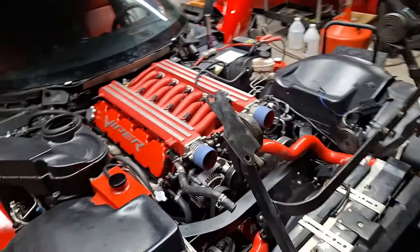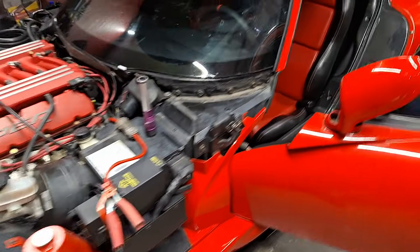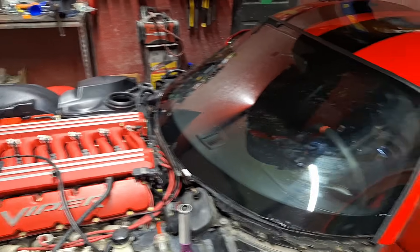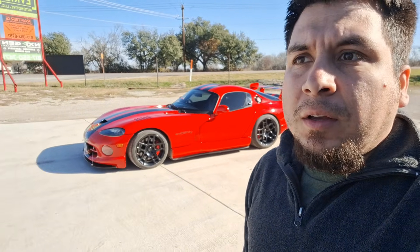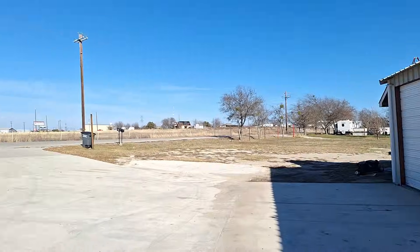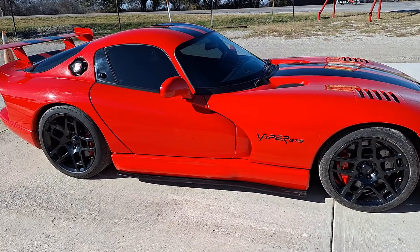I'm going to shut it down. The next video will be a driving video - this will be the end of it. We already did the first oil change and all the test driving. Had a few oil leaks on the valve covers - went ahead and pulled them off and put a bead of sealant around the lower adapter plate and on the valve cover itself. Also had a coolant leak on one of the heater hose piping. I'll show you where right now. We got it - it's ready for the initial break-in and test ride. I'm just going to do a walk-around and one last fire-up before the owner comes to pick her up.